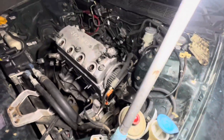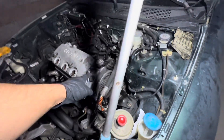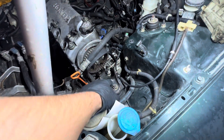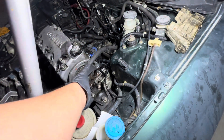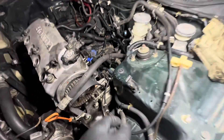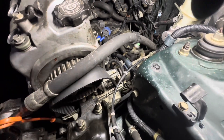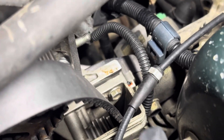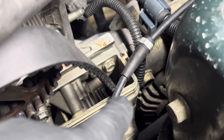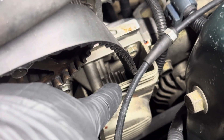We are going to be taking off — I already have the power steering pump off, as you guys know from fixing the head gaskets — and I have to take off this mount, at least this nut, this nut, and this nut, so I can take off this part and slip off the belt and put the new one on. I believe that bolt — let me zoom in — that's the bolt I have to remove because it goes through the water pump as well. The water pump's right up here, you can see the little gear right there.